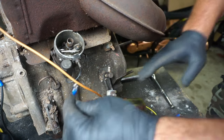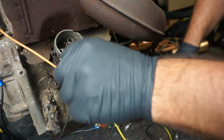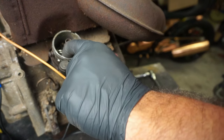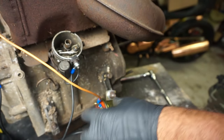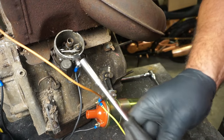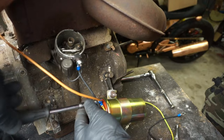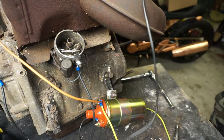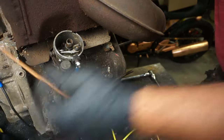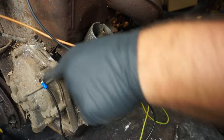And that ground is going to the distributor connector over here. It's gonna make the signal, you know, and then when this connector switches off, opens, this is gonna load the HT coil and we're gonna have the spark. Let's tighten this. Okay, the last wire is the ground, which is going to the battery with this one, plus and the minus, and this wire I just connect anywhere on the engine casing. Decide to put on this kind of bolt.